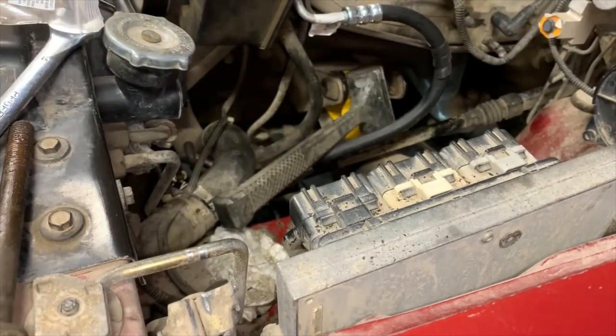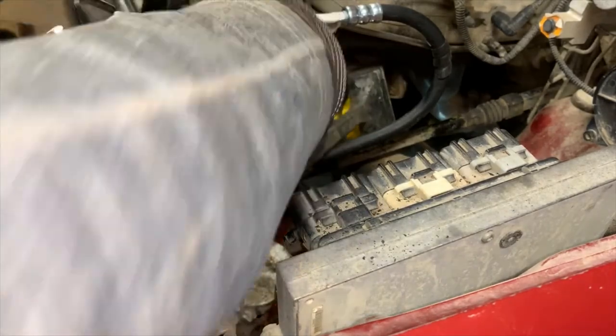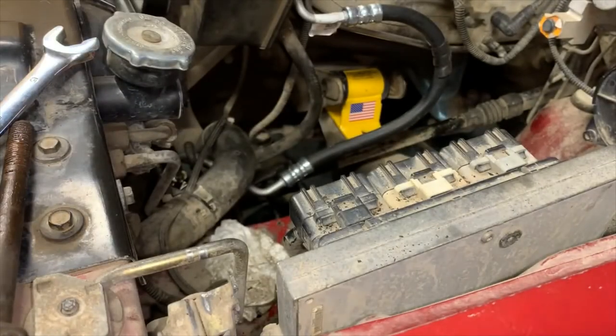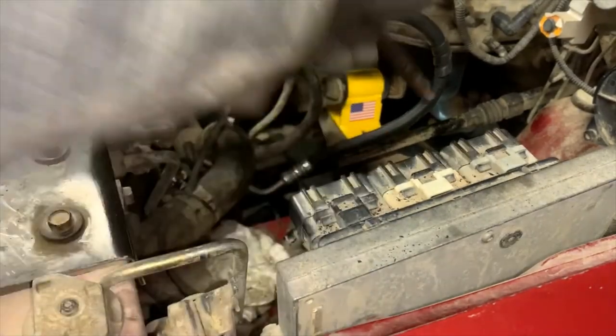All right, we're starting to get close. Probably hard to tell from that angle, just trust me. But we're having trouble getting spot on, so I'm going to take a center punch, put it in there about as far as I can. Then using the power of a dead blow, drive it in.